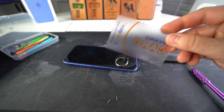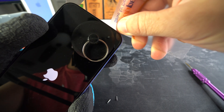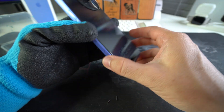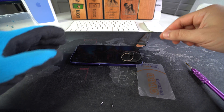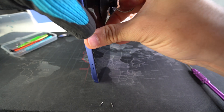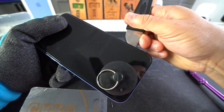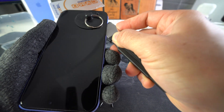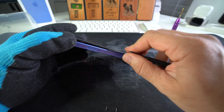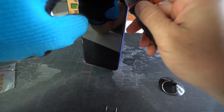We're going to be using this other prying tool — this card — to go around the other side. So we're going to place this prying tool up here and go around the other side with the card. If the phone turns on, which it probably will, you may touch the power button by mistake — just go ahead and power it back off. Now once you have both of these in, we're just going to gently and carefully go down both sides. If you need to use the suction cup for help, you can pull on it. Don't stick the prying tools in too much because there are cables in here and you don't want to damage those cables. We're going to go down this entire side. Just continue working down both sides — it may be a little bit hard to release some of these clips, but just push down gently and carefully so that the prying tool doesn't go in too much. Then we're going to go down this side as well.